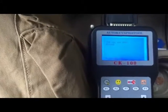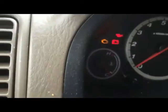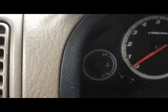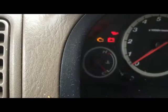The key has been stored — press Enter. Now we need to check. Insert the new programmed key and turn the ignition on. You can see the immobilizer security light right here. If it turns off, it means the key is programmed. You can see the security light blinking; when you turn the ignition on it disappears — that means the key is programmed.